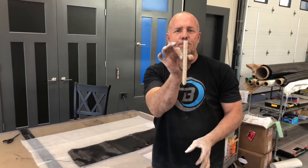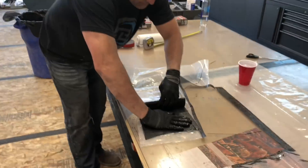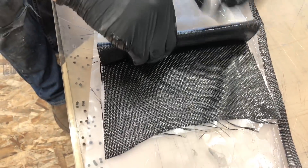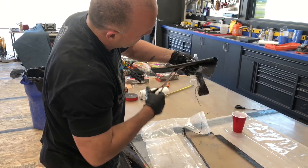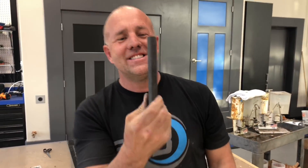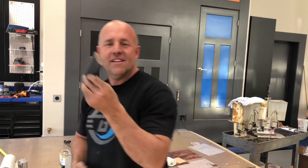I'm going to make the smallest carbon fiber part so far. This is two pieces of single-ply honeycomb fiberglass and I made a little mini airfoil. I need to make a support stilt inside my intake duct to my filter system. Just making that carbon fiber burrito here - anytime you're making tube or bar or anything else, you want to hold it and pull back against it to get it really tight. Then peel ply, bag it. Total time was under 30 minutes. We wrapped it, threw it in the oven, took about eight minutes, pulled it out, quick sanded it, and I'm going to install it. I know it's a tiny part, but that's how we get done.